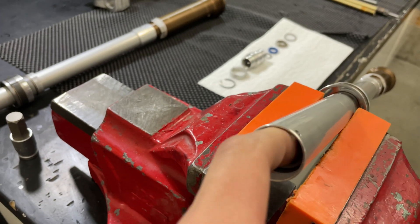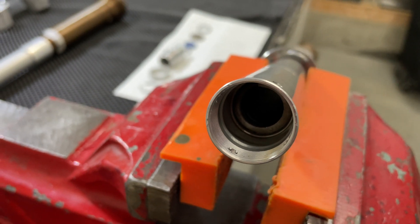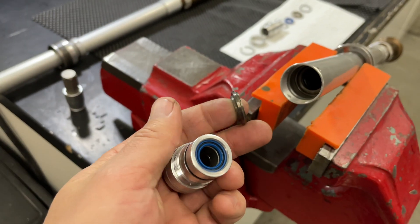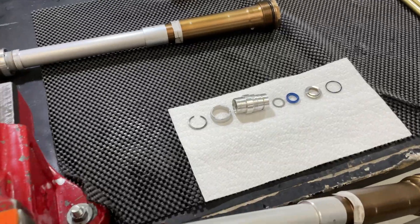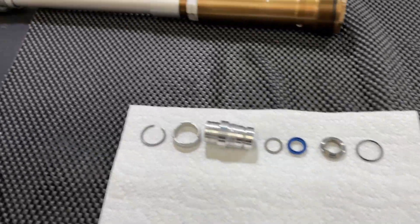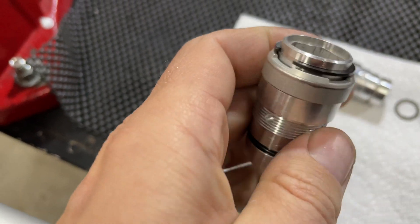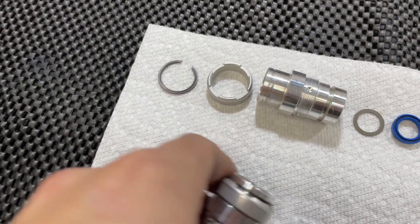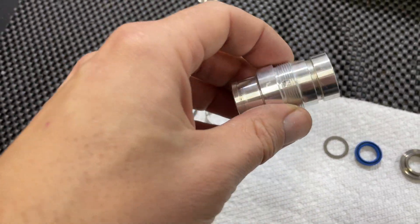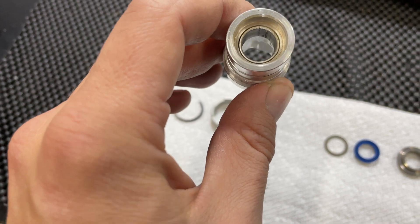There is one piece still in here which I'm going to remove, and behind that you'll see a snap ring with a spring — you don't need to remove any of that. I've got another seal holding assembly here already disassembled so we can see what's inside. On the top you're going to see a circlip, and then this is part of your bottoming cone assembly — you don't have to remove those. There's a bushing inside for your cartridge rod, and you're going to want to inspect it.